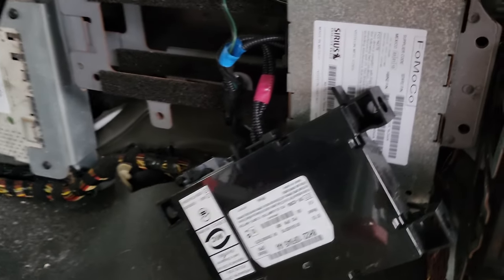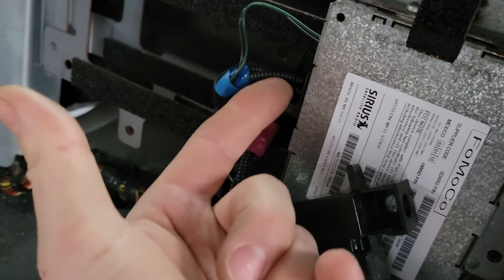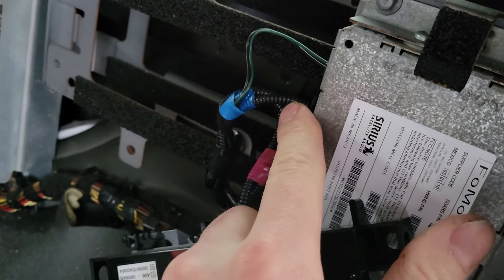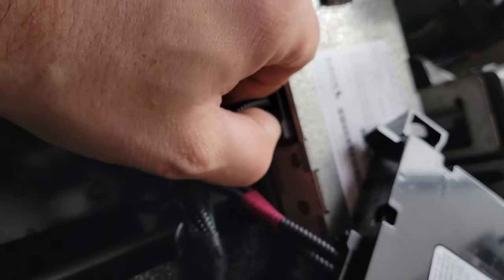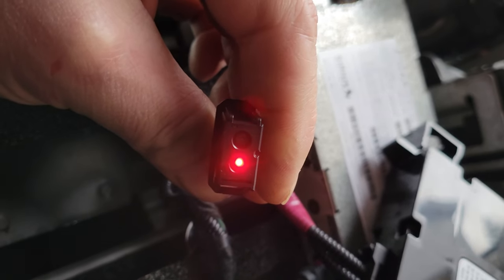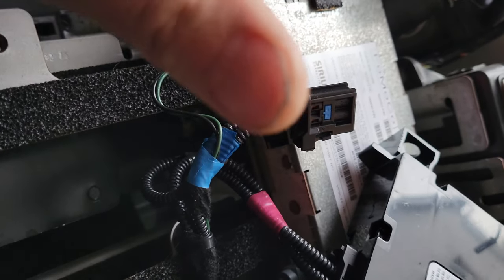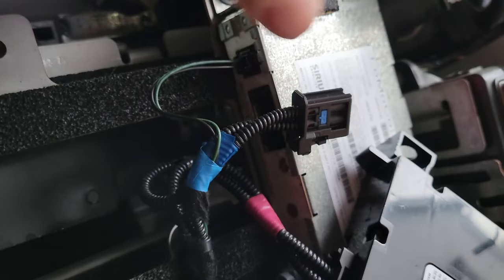What I'm going to do is disconnect some of our plugs. The corrugated wires you see — almost looks like wire loom — that's our optical plug; that's where you'll see the one and two connections coming in. I want to pop that out to see if light is actually coming through, which will test whether that unit is getting signal. Coming from the other angle it's really simple — the clip is at the bottom, just pull it up and pull it out. We got a red light, so we have power going into it. It's flashing, telling us it lost connection. So this unit is sending a signal and it's got to go through to the next module. We have to figure out exactly where the break is.